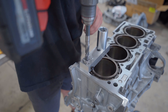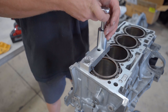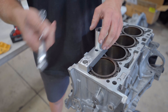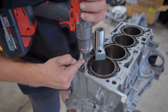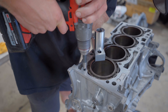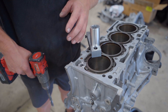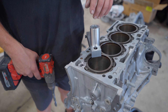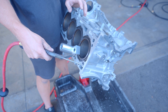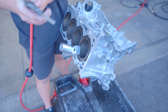You can see the amount of shavings that come out. After the hole gets decently deep, remove the jig so it's out of the way, then drill the hole to the full 99 millimeter depth — you cannot reach that depth with the jig in the way. It is very important you do not go past 99 millimeters, otherwise you will hit the oil passages and get oil getting into your head studs. Now clean out the hole to remove all aluminum shavings — use compressed air with eye protection, or a mini vac.